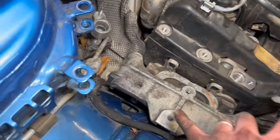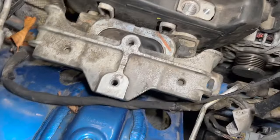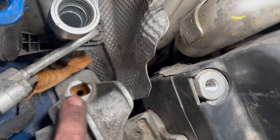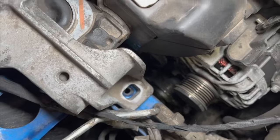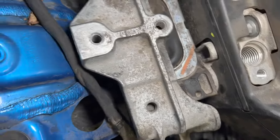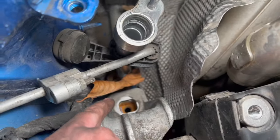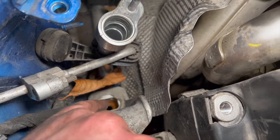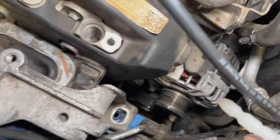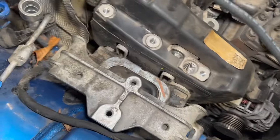The E-torx engine mount bolts are a little awkward with the engine jacked up but not too bad. Lift and lower with the jack to line up the bolt holes. Once the top piece is on, lower gently and line up the two lower bolt holes. Put a bit of grease on the back bolt threads as they tend to get rusty — makes them easier to remove next time.